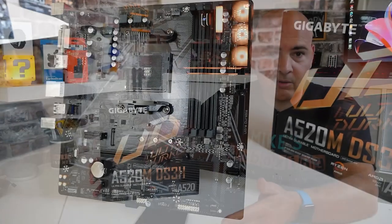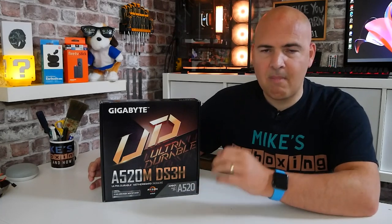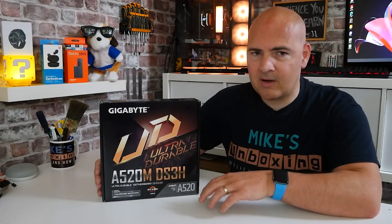You can buy two sticks of RAM now, get dual channel up and running, then maybe a little bit later add another two. If you're planning to use this in an application where memory frequency is everything, you might actually be better off going with the M-K with its two memory slots, which will clock higher frequencies on the RAM due to fewer traces. If you want to overclock your RAM to the highest possible configuration, two slots are going to be better than four.